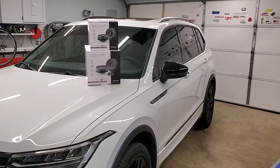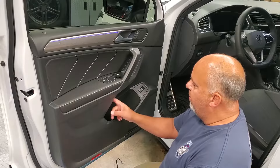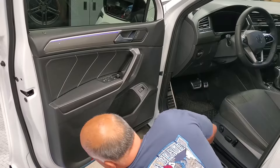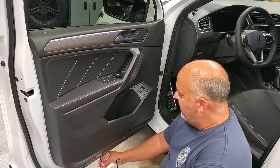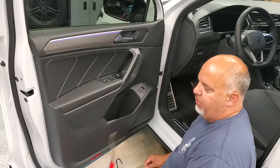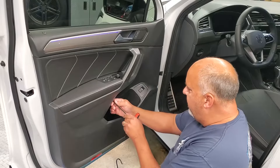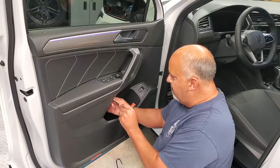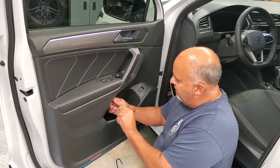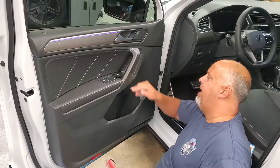Thanks, and hit that like and subscribe button now while you're here — I'd really appreciate it. You won't need very much to take these door panels off. There's a screw right here and some screws behind the handle. You need a 10-millimeter wrench. There's a plastic indexing oval-head screw down here — you just index that straight up and down — and then use your standard pry tool to keep from scratching the paint. This is the T30 Torx bit you'll need.